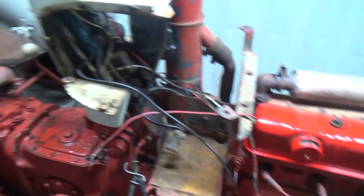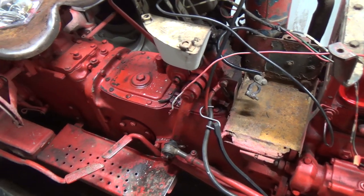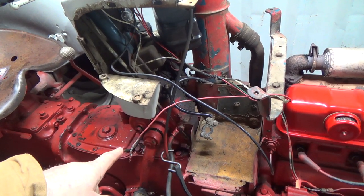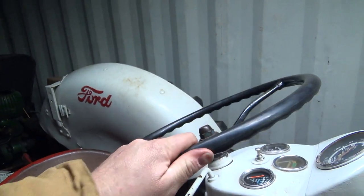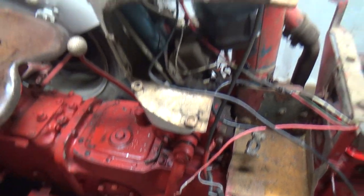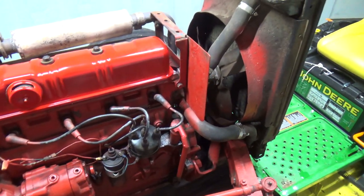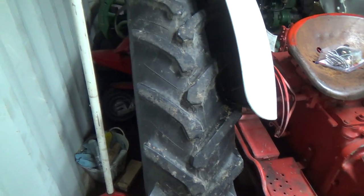You guys, holy cow, you wouldn't believe how much that costs for the steering box. And I probably could find one somewhere around here, but it might not be any better than this one. You know, if you want it to be good, you got to get it pretty much brand new. I think they're brand new. There was a place I found too that did rebuilds. But there are these adjustments here, and all that really adjusts was this. This is a little tighter now because the one on the other side was way out, so I adjusted it, and I messed with both of them, and it didn't change that at all, so something's worn out inside of there, I guess. So, anywho, lots of fun. Lots of fun. Anyways, this would be a pretty darn good tractor, I think, when she's ready to rock.